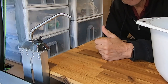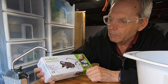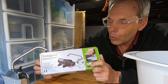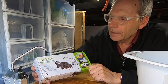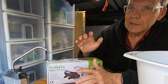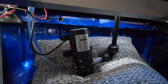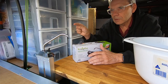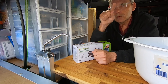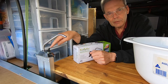This particular pump pumps about 4.5 litres per minute, which is quite a bit — much more than you need for the kitchen. The details will be in the description. The pump can be up to about 1.5 metres above the water source, so it has enough suction. I found that if you mount the pump in a vertical manner so the motor is vertical and the inlet and outlet are horizontal before the hose goes back up, the water doesn't siphon itself out. In this case the pump is below the water source.